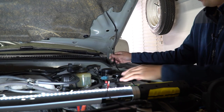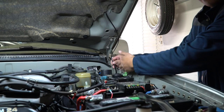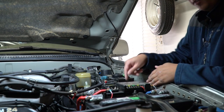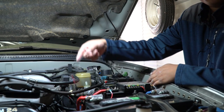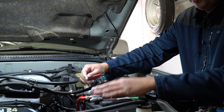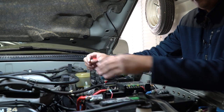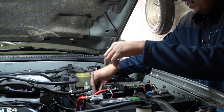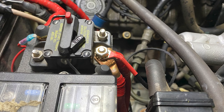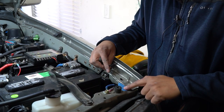Next step is to run the wire to the battery — we're going to run it along right behind the evap. I was able to run the wire behind the evap; if you need to take that apart you can do so with a 10-millimeter. You want the positive wire over towards the battery side. In my case, I'm connecting it to my circuit breaker rather than directly to the battery — make sure you disconnect the negative first. The ground wire should go towards the front where we'll be hooking it up to the hood pin switch.